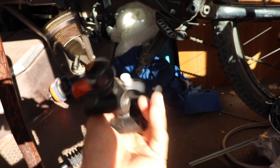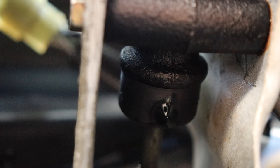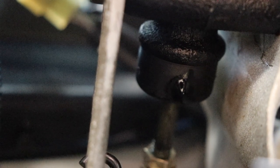That's the clutch master cylinder - as you can see, it's leaking fluid. So obviously the seal somewhere's gone. It's leaking fluid and that could also explain why there was a lot of black dirty gunk down the bottom when we bled it from the slave.